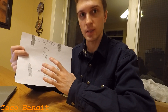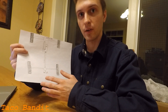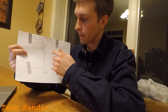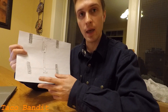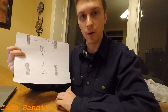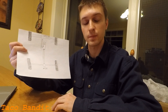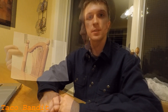Toyota uses the braking system to achieve the same outcome as a regular mechanical limited slip differential. So when you put your truck in four-wheel drive, there's no way to turn on the auto limited slip differential. Your wheels are only getting as much power as the road allows them to, essentially. So if you are in some sort of slippery condition, you're going to slip and slide — you can't do much about that.